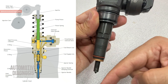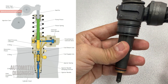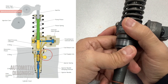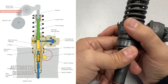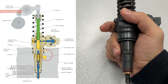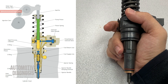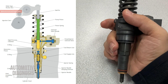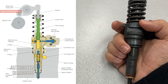At the center we have the high pressure chamber, which is responsible for pressurizing the fuel trapped inside the injector before it gets sprayed. The fuel supply line is integrated into the cylinder head, as I showed on the engine earlier. That supply line feeds fuel from the fuel pump to the injectors, but this pressure is not high enough to inject a fine fuel spray into the combustion chamber - that's why the injector has to increase the pressure.